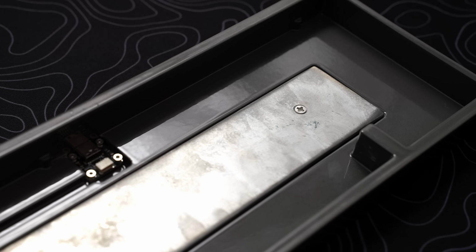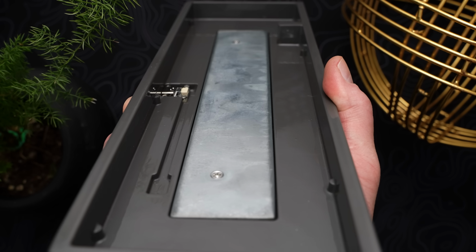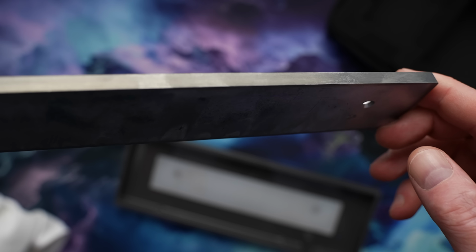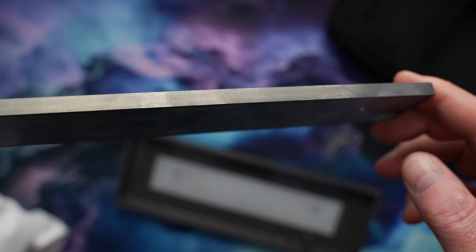The zinc weight, I'm just not a fan of. It delivers a hollow sound and adds this metallic resonance that really rubs my ears the wrong way. It increases the volume of the board overall and it amplifies anything negative you may have going on with your switch. To run this weight, you need lubed switches for sure, and some polyfill, and even then, I'm still not a fan. My favorite way to run the board stock is with no insert at all.